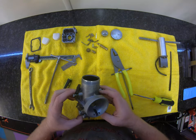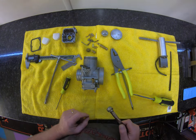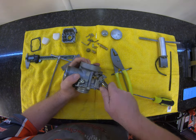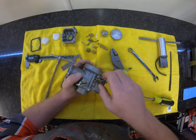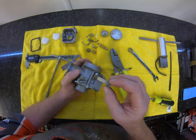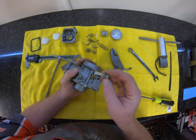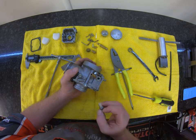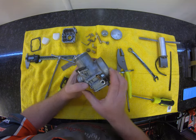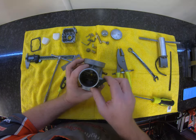On the side — 12mm. We've seen carbs come in two years old and this part here has never been checked. If you're not filtering your fuel, this is going to be caked up completely. Check this anyway, because new carbs do not come through with this filter on. So if you're not filtering your fuel, you've got nothing in line — you're just going to fill that up with crap completely in there.